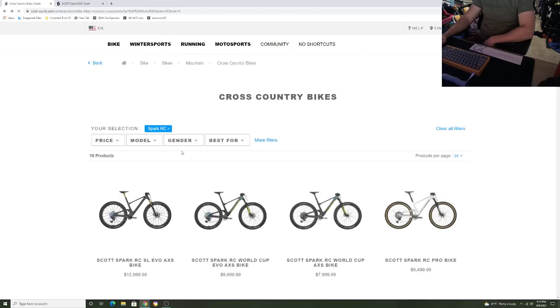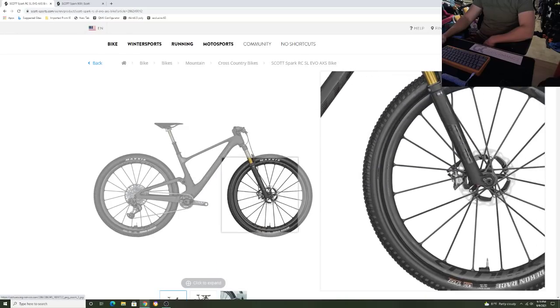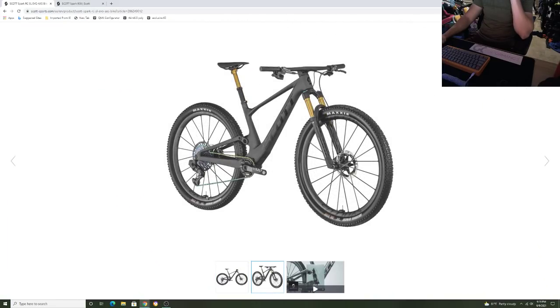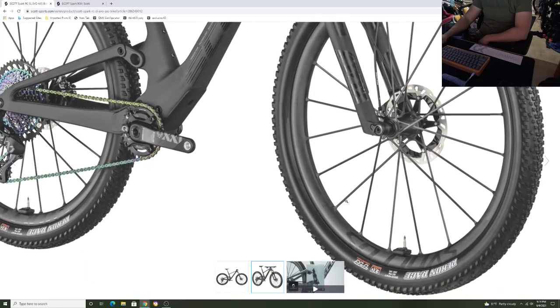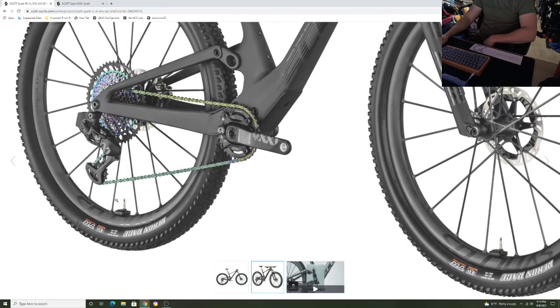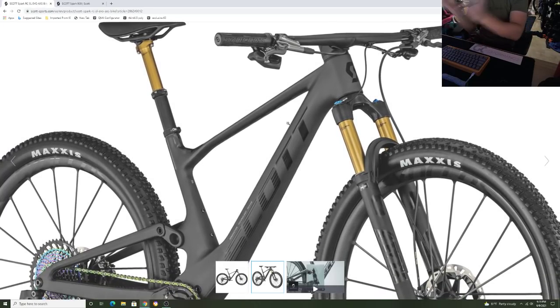Also with the new Scott Silverton wheels, they are different from last year. These are their one-piece carbon fiber wheels. They actually changed the inner diameter — instead of being 26 millimeter internal width, they're now 30 millimeter internal width. So they're actually new for this year. They're going a little bit wider, like everyone else, to allow you to run a little bit lower tire pressure. And on some certain models, they added a tire gauge reader for pressure.